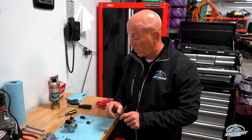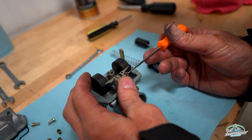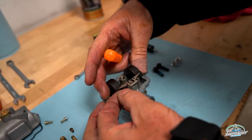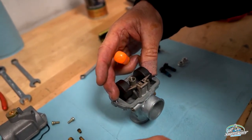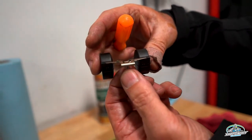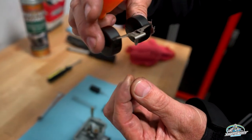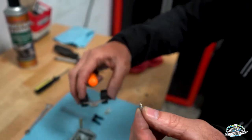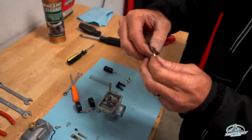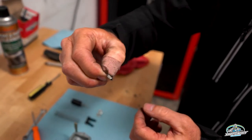There's one final step — the actual removal of the float needle. There's a pin that actually holds this in here. You can just poke it; you'll notice it comes out one side — just hang on to it with your hand and keep your hands on the floats themselves. As you lift this out, be very careful because the actual float needle is sitting on a wire, and as you pull it forward you can actually take it off — it slides in and off the floats. The floats look pretty good in this cart but are a little bit sticky — I would still clean them, and the float needle itself I would either replace or do a very good cleaning on it.